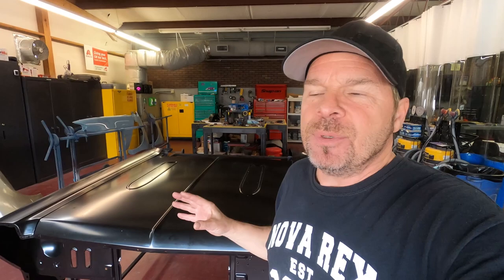All told, we've got way less than $300 in this stand. And although it's not chump change, money's money. But it gives me the ability to mount any sheet metal on this stand because all my mounting points are adjustable — just like a rotisserie. You have to fab some stuff up, but it gives me the three-dimensional capability of working, blocking, painting, or polishing my parts before reassembly during a restoration. You don't have to stack panels up in a corner. For a one-man shop, it really matters and it helps.